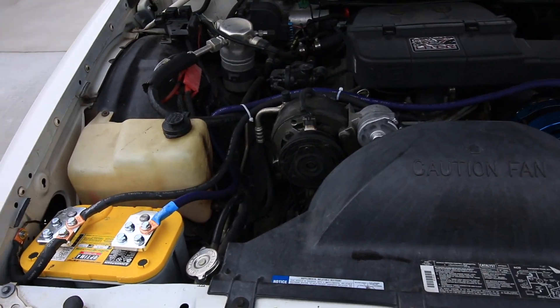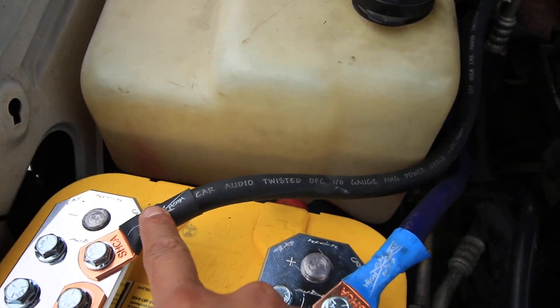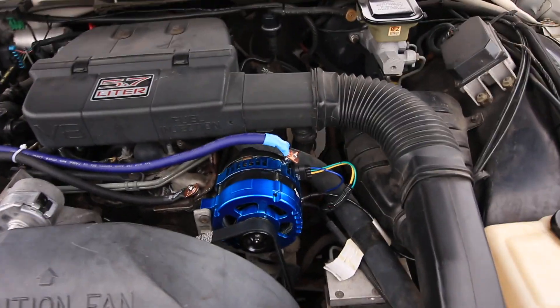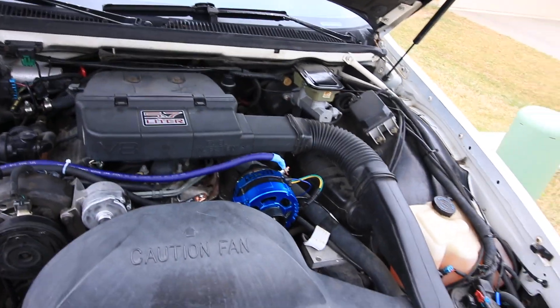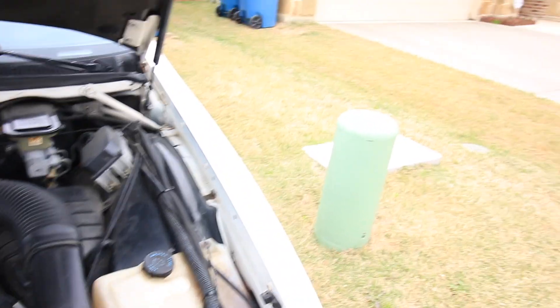So the Big Three — you're upgrading your power wires. Some people do four; I did four and I'll tell you guys why. For starters, your ground: one ground goes to the chassis to the body. Number two goes from the battery to the engine — that's two. And then power from the battery to power on the alternator — that's three. Now what makes it four: I've got the alternator grounded to the body as well. That's four — one, two, three, and four.